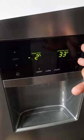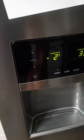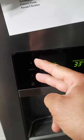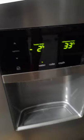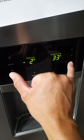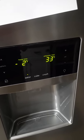If you press the plus and the minus together, it sets a defrost. If you press the up and the down together, it starts a manual diagnostic where you go through the menu and force it to do every single thing you want. If you press the down and the minus together, it goes into a self-diagnostic mode. But there are a couple of tricks to that.